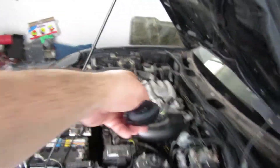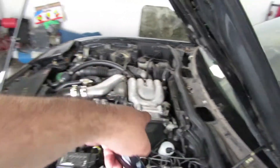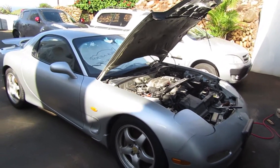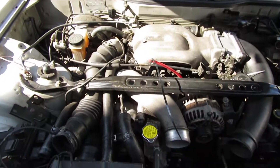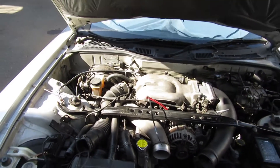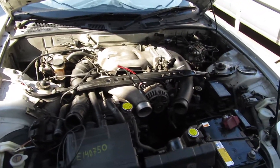What I did is I pulled the idle control solenoid from this car, moved it across to the silver one, and the car is giving me the same symptoms. So I put everything back together, made sure the black one starts, and now I'm back to messing around with vacuums. I'm glad I found a problem with one vacuum lead — I temporarily fixed it — but I tried to start it and still have the same problems: misfiring, spluttering, etc.